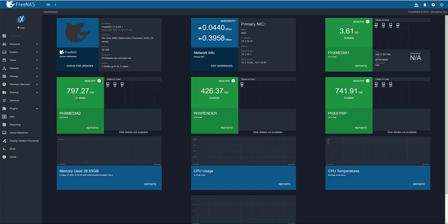What I did was I bought an SSD. In this machine I actually have a SAS controller. A SATA drive and a SAS drive are very similar except for the connector. SAS drives are usually used in the enterprise environment. SAS connectors are really cool because you can get a SAS-to-SATA connector. I have a SAS card and the nice thing about it is it only has two ports, but off those two ports I get eight drives. The motherboard also has an additional six SATA connections.